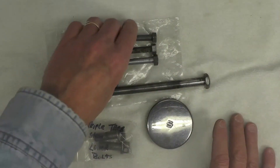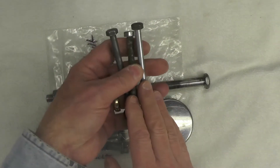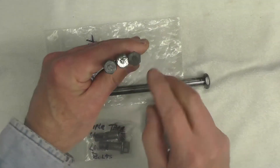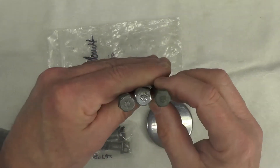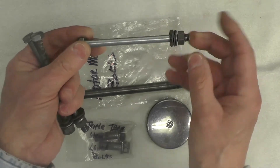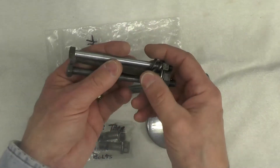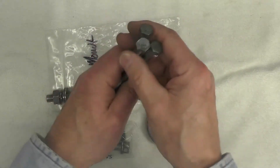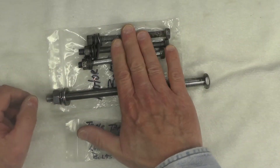In this case though, let's take a look at the motor mount bolts — there are three of them. The reason I'm replating these is, number one, they're no longer available from Suzuki, though you can probably find them NOS on eBay. But the real reason I'm replating these is they have the stylized S on all three that I want to preserve. I could go out and buy this bolt in the right length and thread pitch, but it wouldn't have the Suzuki S on it. Most people would never notice, but that doesn't work for me for a restoration. I want to preserve everything I possibly can, and I have the means to replate these myself.